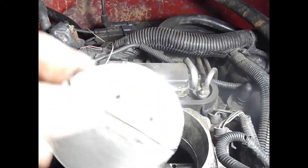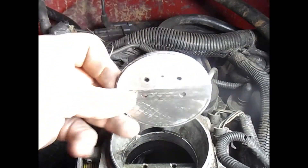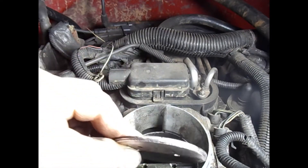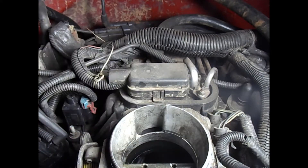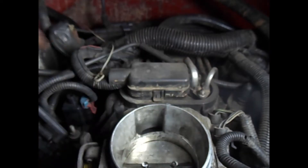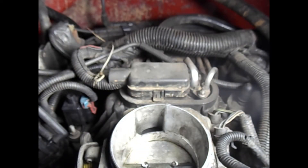Take your diffuser, put it back in the same way you took it out. That's the side we cut off, that's the side that came out first, so you wanna slide it on in there like a disc. Open her up, wiggle it back in there until she sits flush. I'm using threadlocker — the blue — but use what you got.